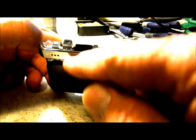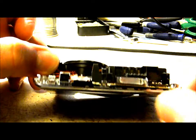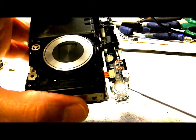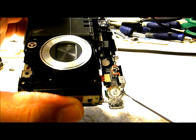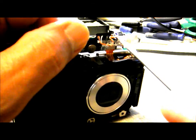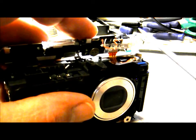We need to take off the top trim bar to gain access to our shutter and power board. In this corner you'll see a clear piece of plastic with a clip on each side — we need to disengage those clips. We also need to remove our microphone: just work the microphone up out of the little square piece where the white and orange wires go in.